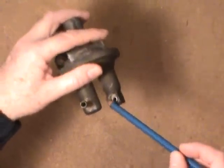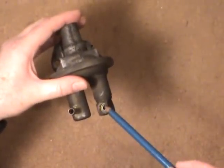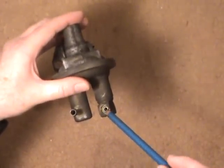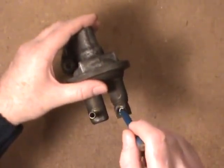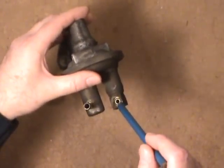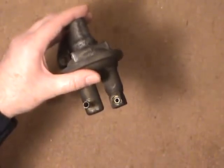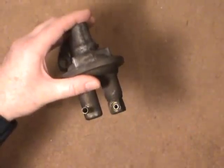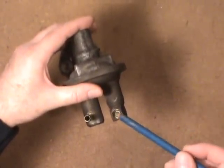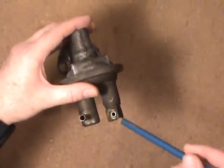The other one is under pressure. These ones put out somewhere between 5 and 7 psi when they're running. There's a tapered seat in here — you would have a tapered steel fuel line with a nut, you tighten it down, much like a brake line would be, only this is a bit larger. And this would feed up to a canister filter and then on to the carburetor.